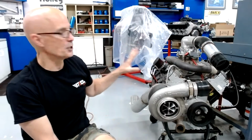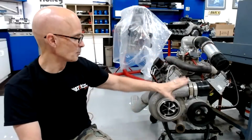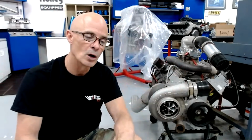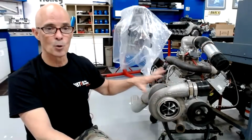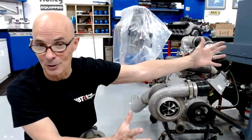And then the motor that you choose obviously dictates how much horsepower you're going to make per pound of boost. And then look at the other things. Okay, how is my turbo doing? How's my back pressure doing? How is the pressure drop across the intercooler core? How is my temperature gain? Like, how much heat is the intercooler taking out? You can start looking at all of those things to figure out, hey, even if I put a bigger turbo on there, one that was more efficient and had more flow capacity, if my intercooler is still robbing me of 3 pounds of boost, the turbo is really not where I need to look. I need to look at that intercooler, obviously.